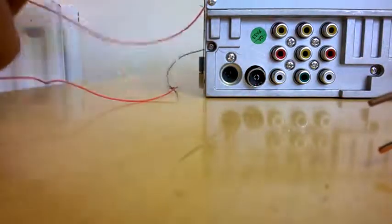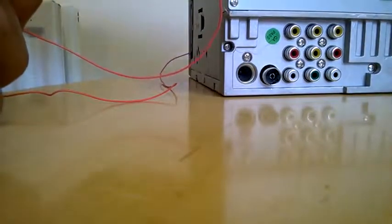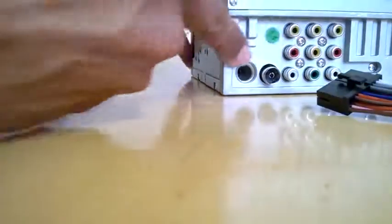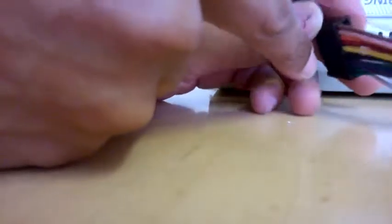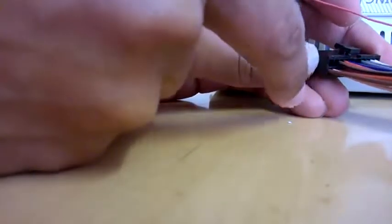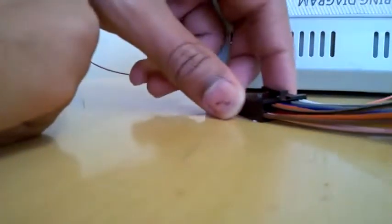I'll show you the wiring one more time. On the aftermarket harness diagram, you'll see 'NC', 'NC1', and 'NC2' — NC means not connected. There's no wire in those positions, so you don't need to connect them. There's also a number six position that says NC with no wire. Don't get confused by those. And regarding the pink wire for rear view camera — many people ask about this, and I've shown you how it works. Thanks for watching.